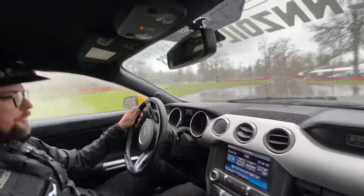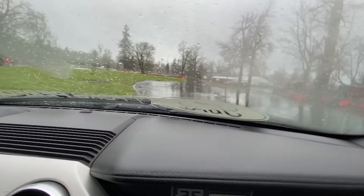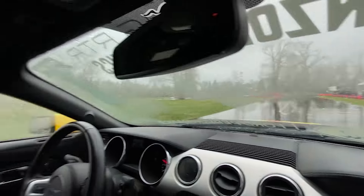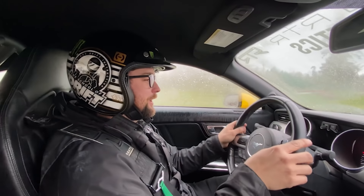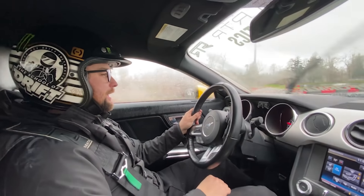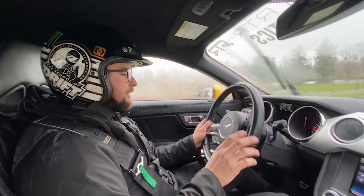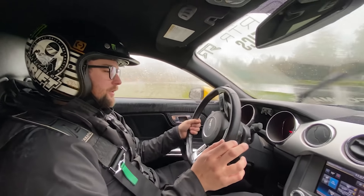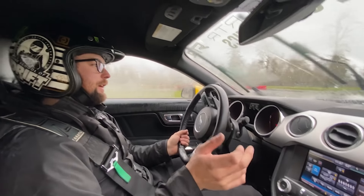Gundy's was nice enough to ship some down last night, because I literally fired the car up to pull it into the shop and realized - you idiot, you can't even put these on right now. The modified knuckle is what this bolts to, so if it's already been modified you've got nothing to bolt this to. I called them yesterday afternoon and they pulled them off and sent them down. Big thanks to them. Make sure you have stock knuckles - obviously that's a priority.